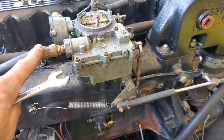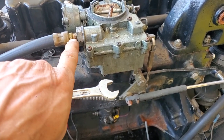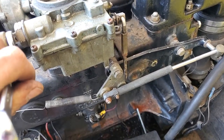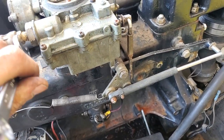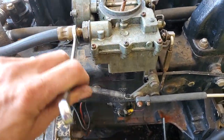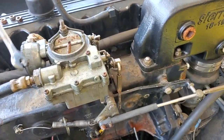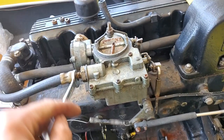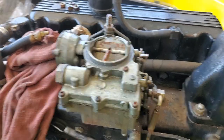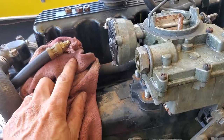Sometimes what you'll find — this is a very old style — sometimes this nut will have a tendency to turn before it unscrews, so just hold it with a big adjustable wrench. This one seems to be coming off real easy. Oh, there's a bit of fuel pressure. Let me just snug that back down for a second — I need to get a rag quick. Alright, I've wrapped a rag around here. I got the fuel inlet off, just got a rag there in case it carries on dripping.